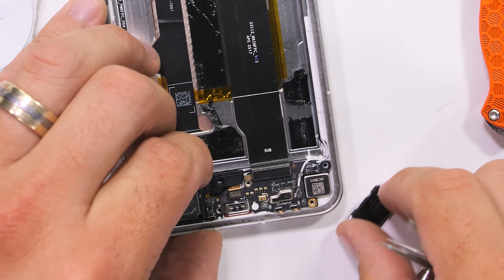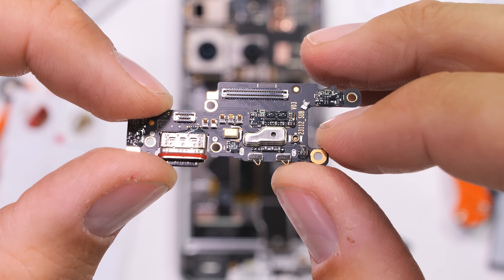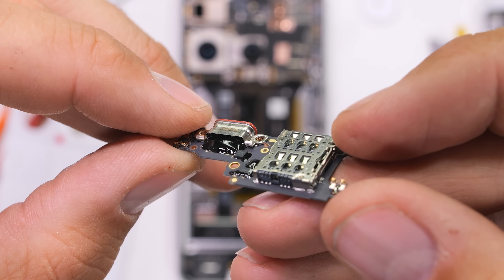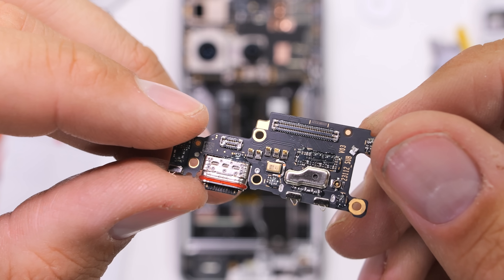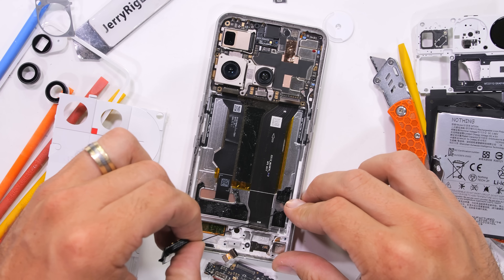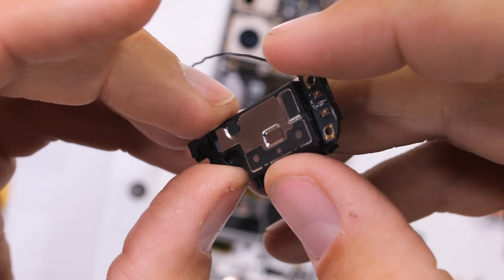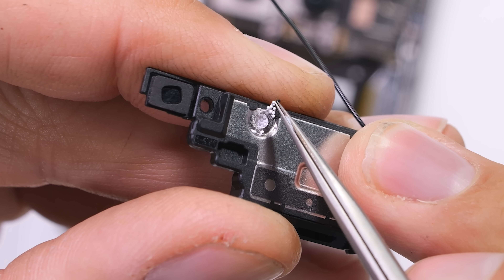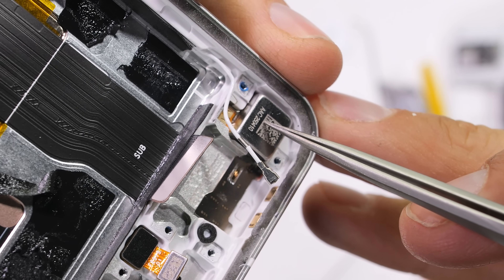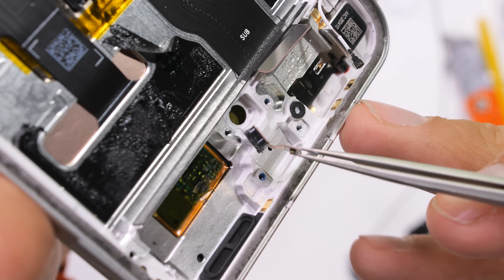Under the battery, we see a rather large copper vapor chamber that continues upward under the motherboard. At first glance the speaker is kind of small. Removing three more screws, we pull out the charging port board. This guy can charge up at a very impressive 65 watts. It has a red rubber ring for waterproofing, and Nothing says they've tested the durability of this port to 30,000 insertions — that's like once a day for 82 years, which is longer than the average human lifespan. Down here at the bottom of the phone we have our square haptic vibrator, the waterproofing mesh over the loudspeaker opening, and the tiny optical fingerprint scanning underscreen camera.